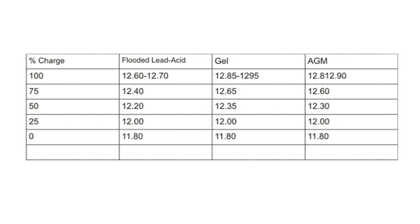The problem with different battery types is they require a different charging voltage. As we've had flooded batteries for over a century, they're very tolerant — as long as we're about a volt above in our charging, so if the battery's at 12.8, the alternator's got to be at least 13.8 to 14 volts, and when it's fully charged, usually our voltmeter will read somewhere around 14.2 volts. This minimizes the current the alternator drives into the battery, as the battery's internal resistance changes as it comes up on full charge, and this resists the amperage from the alternator.